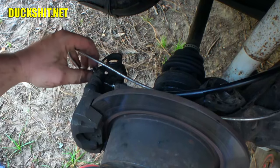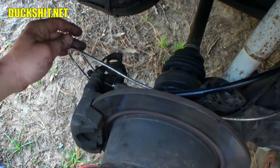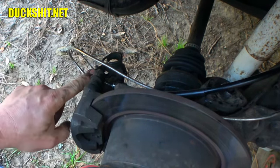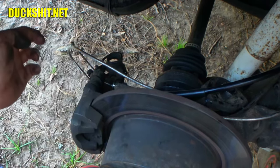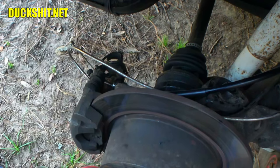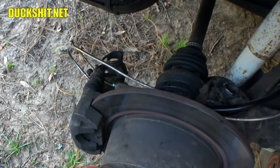Now you've got to pull this back just a few inches — about four and a half inches, roughly the width of my fist. There's a reason for that: when we go in the car we're going to fish the cable out of the chassis, and it has to be back a little bit. If it goes way past the hole then you have to pull it out, which means you could put a kink in it and have a bad day for the condition of the cable. We're good — let's get up front and pull it out of the chassis.